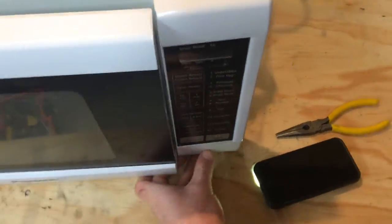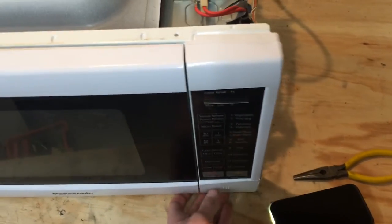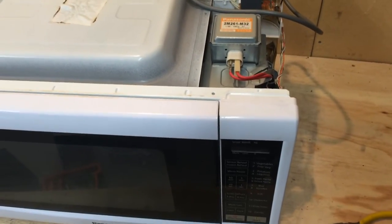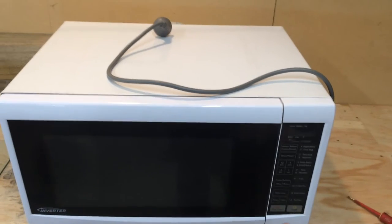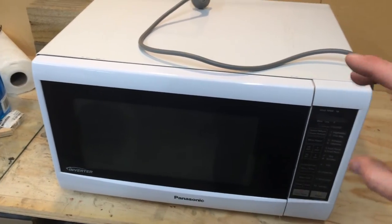So that door shuts, it's positively shutting, and all the micro switches are being activated so that it's going to be able to start all right. All we've got to do now is put the cover back on and obviously do an earth leakage and insulation resistance test and the usual safety tests on that. If you close the door and it feels a bit spongy closing and it won't start, that's usually with the latch. I'll show you how to fix that.